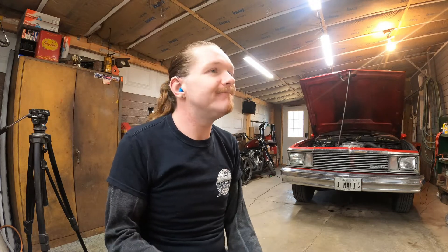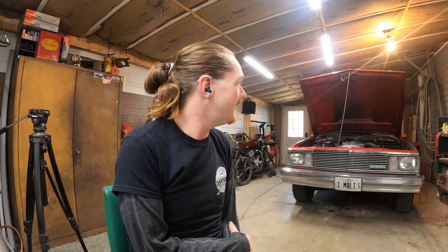The difference in fuel economy this thing has been getting versus before is astronomical. It has been averaging 10 to 12 miles per gallon, and it used to average 16 to 18 miles per gallon. I've read the plugs twice since I had this new carburetor put on, and it's rich — like really in-your-face rich. Like Richard Rawlings from Gas Monkey rich.